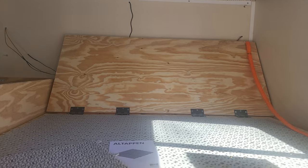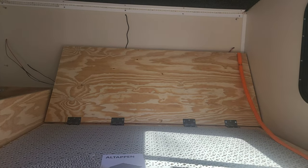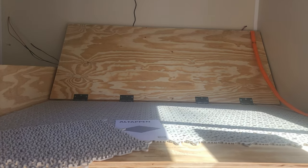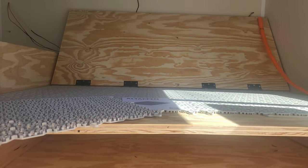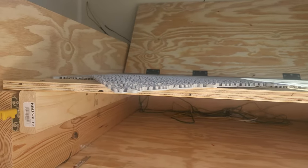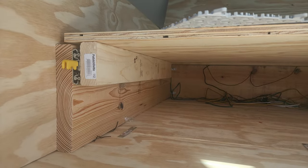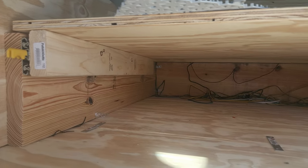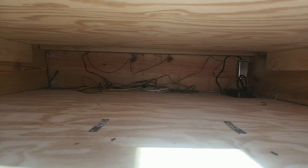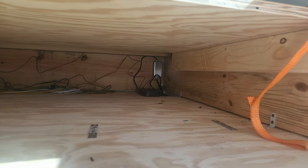In couch mode, the couch only comes out 42 inches. We have two 30-inch heavy-duty locking slides that we got from Amazon, and those are rated at 440 pounds apiece. We have those mounted on 2x10s, which gives us approximately 9.5 inches of height. That's 42 inches deep at the front of the couch, giving us just a ton of room.